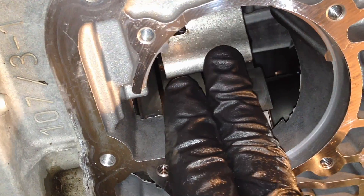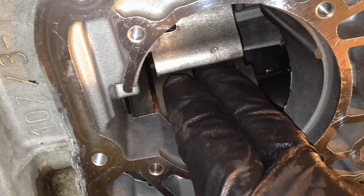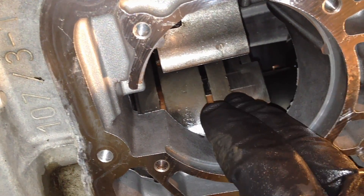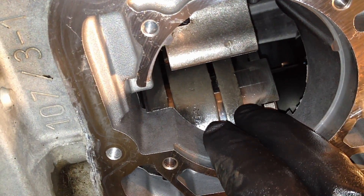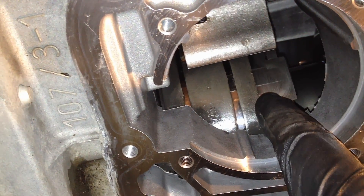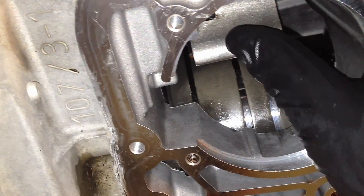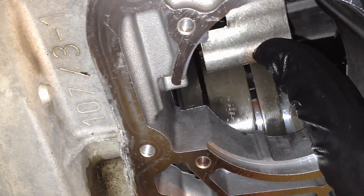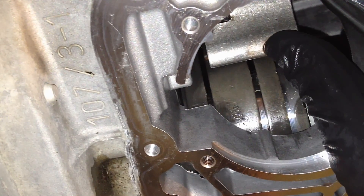While we're in here, might as well check the actuator and the band itself and the welds on the band, because they break all the time where the actuator clips in. There's also a strut part on the other side that goes into the welds on the band, but you can't see that one. The least we can do is look at the band to see that it's got good friction material — you can see the brown material from the side a little bit — and make sure it's not all black. If the drum's not all blue from slipping, and it starts tightening within about three quarters of an inch, the band is just fine.